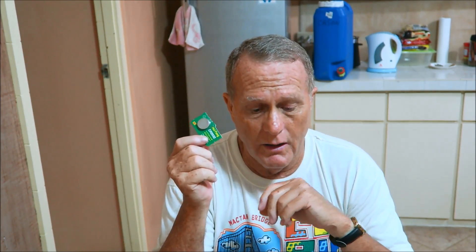You're going to need to get another hard drive and you may have some other issues. I've already put a new hard drive in, bought it, got it in, loaded up Windows 7 and upgraded to Windows 10 — so it's working. But we've got some other issues with the laptop. We're going to do three things today: put in a new CMOS battery — that keeps your clock on and keeps your BIOS current. Number two, the Wi-Fi didn't work. I knew when Joe got his apartment he had to hard-wire to PLDT for internet, which indicated a Wi-Fi issue.